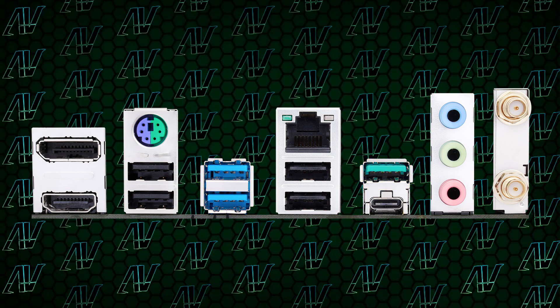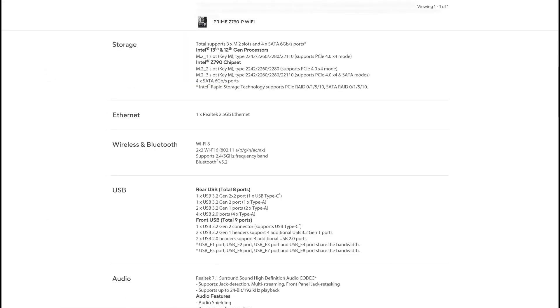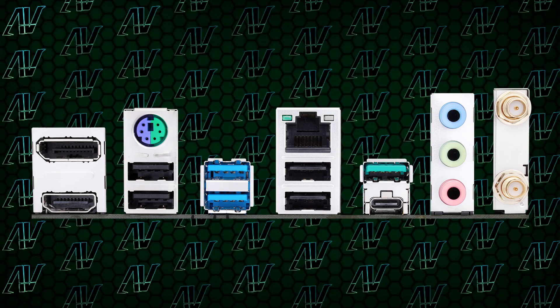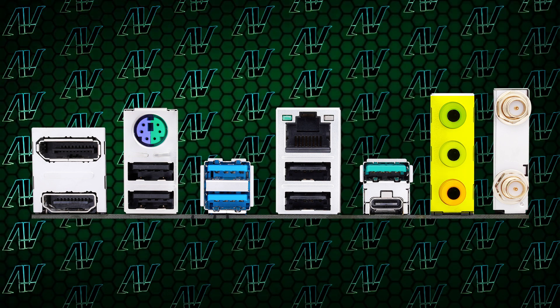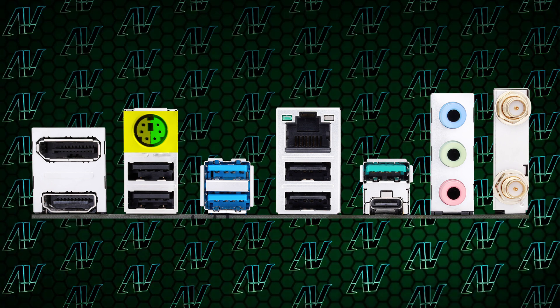At least the singular included USB Type-C port is rated at 20 gigabits per second. Add to that integrated HDMI and DisplayPort, 2.5 gig Ethernet, optional Wi-Fi 6 — and yes, you heard me right, Wi-Fi 6, not Wi-Fi 6E, which is pretty much the standard on all Z790 and other current-gen motherboards, even more budget ones — so good job there, Asus. And then to top it off, only a mere three audio jacks. But hey, at least you get PS2 for the one or two people who are going to care about that.